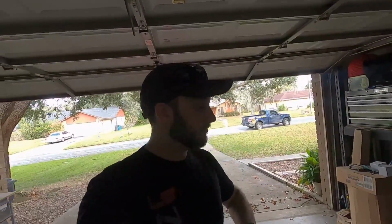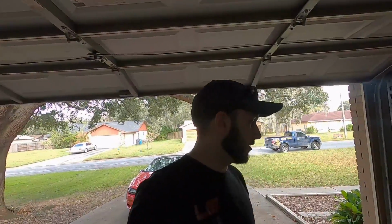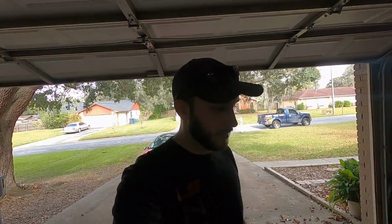Starting with thing number 1. First thing, as you could see when I tried to start it, the cam sensor does not like to start. The wiring in these things is pretty shoddy. It's a 90s GM car, wiring's all just junk basically, but we're working with what we got here, you know? With that being said, everything does work, but it's just not perfect. That's the main wiring issue with the car, the cam sensor wiring harness. It goes to the ECM, and it doesn't always work right.